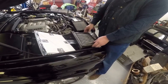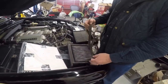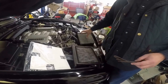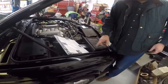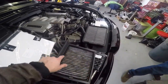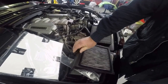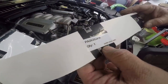These are the charcoal ones, but we're going to move forward to the other ones. I think everybody will have the understanding of what they have to do. Don't get these air filters without contacting a Bentley dealer — I don't know if the ALCO company provides these seals. You need the one for here and the one I've just explained. There's one that will go around the filter. The Bentley part number for that seal is PA26393PA — you'll need two of those.